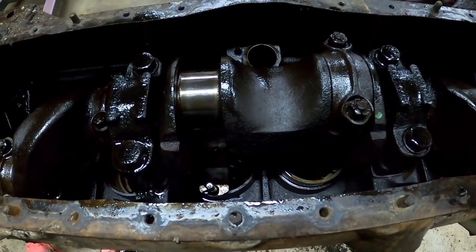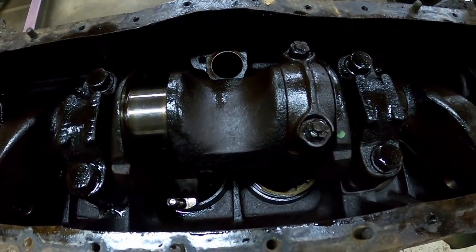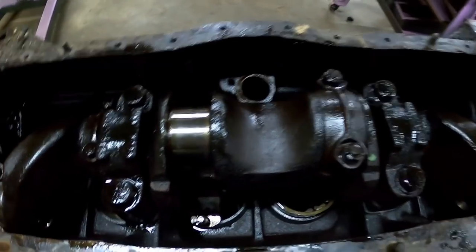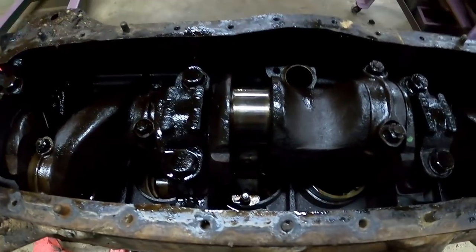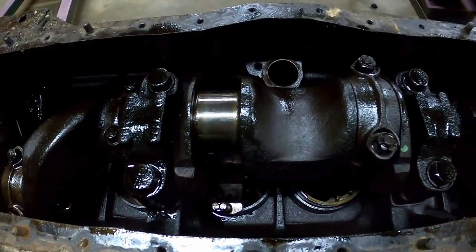Normally there's a tool called a reamer that can take that top edge off and smooth it out. I'm going to try to just get the crank out — I'll either pull them this way or drive the sleeve out, and the pistons will just stay with the sleeve.